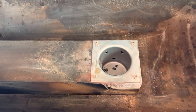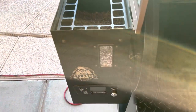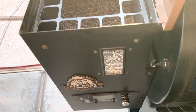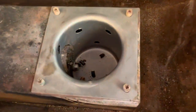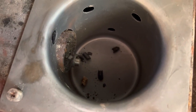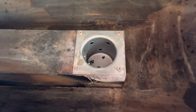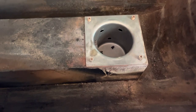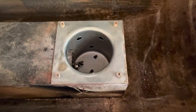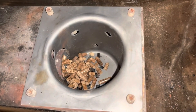Worst thing that can happen — I'll take it apart again. We've got our hopper assembly all back together, the plate on the bottom is back on, and we've refilled the pellets. You can see that igniter rod is only sticking out about an eighth to a quarter inch — we don't want it too far in. We're plugged in, ready to go, and we're going to go ahead and start the grill. Pellets are feeding in nicely.